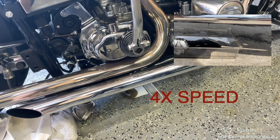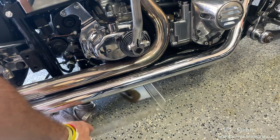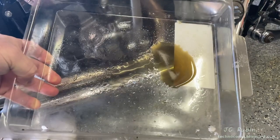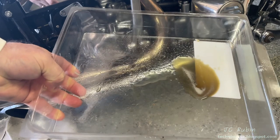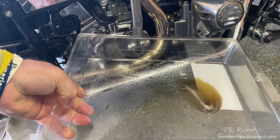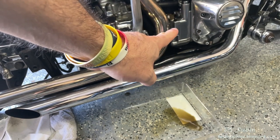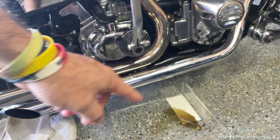All we saw was that tiny amount, and with the engine actually running we see some splatter from oil in the hose and breather, but no appreciable amount of oil pouring into the container from the case. Already we have a night and day difference — no doubt about it, the repair worked. If I ran this out on the highway and cleared all the residual oil stuck in the breather and surrounding parts, I could probably further reduce it to just a couple of drips after a couple of weeks. That concludes this video on the successful repair of a shovelhead oil pump check valve — I'll know the true extent when I run the bike out and put it up for the same amount of time.